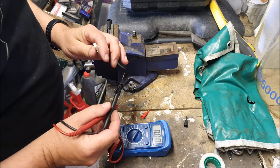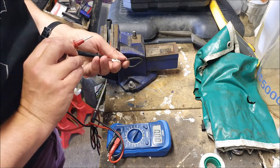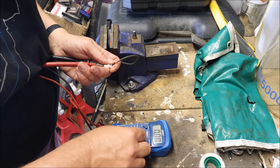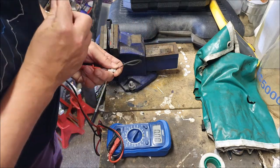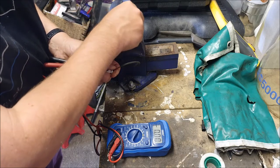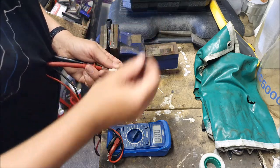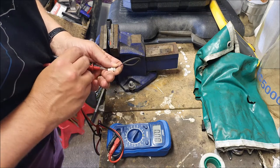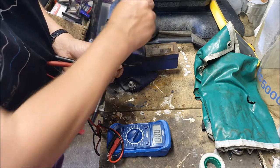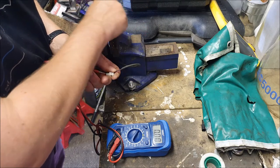The problem is these are really tiny little plugs, so trying to get a connection with the multimeter isn't easy. We've got the meter on 20 volts, so it should pick up any small current, and then we pass the magnet over. I'm still picking up zero. I don't know if I'm making a proper contact in here or not - it'd be nice to have one that worked so we could see what the difference was. But this is as close to confirmation as I can get that this sensor is bad.